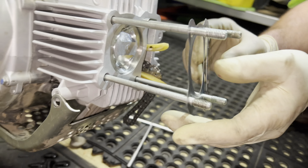There she is — nice. Now we'll go ahead and check the head out, clean the bottom of this off real quick. Head gets slid on now. Make sure you got the base gasket and the two dowel pins in — I'm holding the chain right here. The dowel pin — oh there we go. Alright. She's on. TDC coming right up. Copper washer goes at the bottom right here. Clean this off. It's a 143 — just like that, we got a 143. I just go hand tight with those for now. The other two as well on the inside.